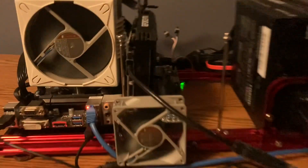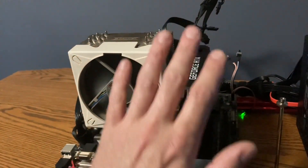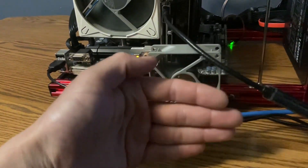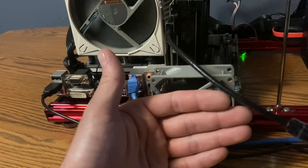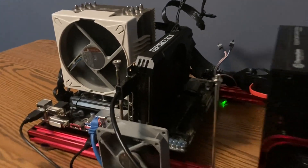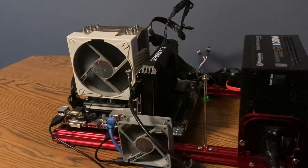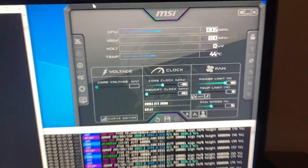I'd say it's worth getting this cooler and switching your A4000 out if you mine with it — it's definitely way cooler, it moves a lot more air. I feel a lot more air coming out the shroud. With the factory fan I did have this one actually pulling, so this is pulling all the hot air out this way — I don't even need it anymore, it doesn't even feel hot. I can probably turn the fans down to about 60 or 55 and keep it a little quieter. This is my bedroom so I do sleep beside this thing. I got this one for $50 Canadian so it wasn't too expensive — figured I'd just show you guys the difference. See you guys next time, thanks for watching.